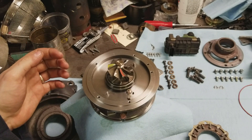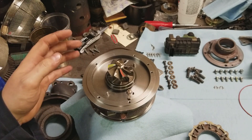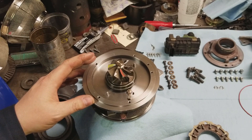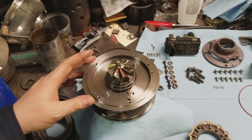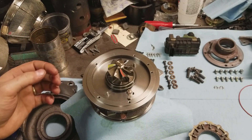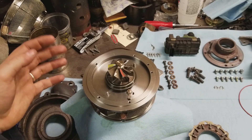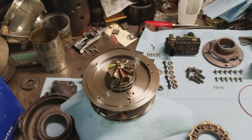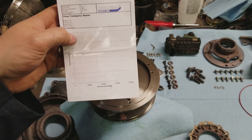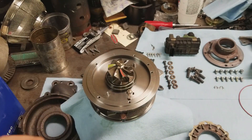This is the new turbo core I bought. It's actually not OE — it's not Garrett. It's actually Chinese, made by a company called Powertech. They're a Chinese company and they seem to make pretty good products. Their turbo cores are built in China and balanced in the UK by a company called Turbotechnics — there's a spec sheet in here for the vibration and balancing. I installed one of these on another OM642 about two years ago and it's working flawlessly. This is purely mechanical — there's no electronics or anything in this that you need to worry about.